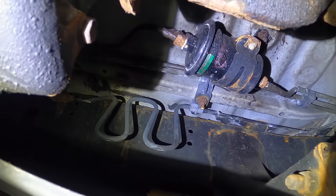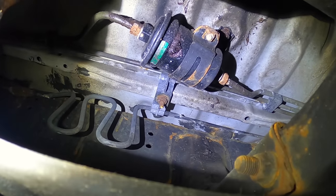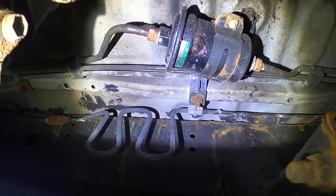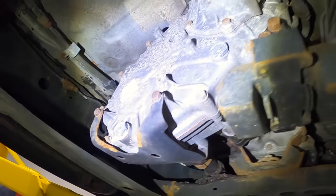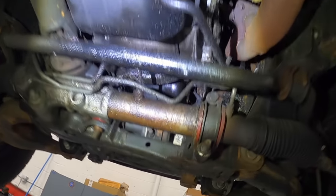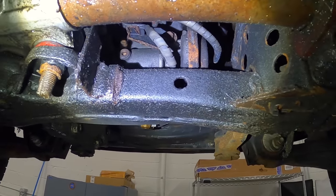This is an old school truck, so it has a fuel filter. This one looks like it hasn't been taken off in a very long time. It's very rare to cause issues, but see how rusty these lines are — these likely won't be coming off, so that's going to open a new can of worms. Transfer case — good old transfer case. These rarely leak and rarely have any issues, other than the ADD actuator that's vacuum-activated is notorious to seize when you don't use your four-wheel drive.